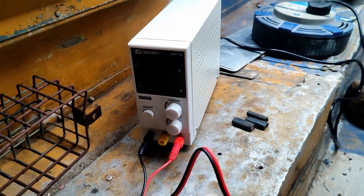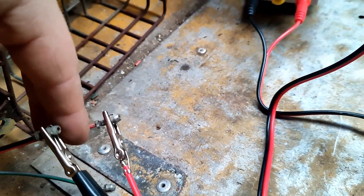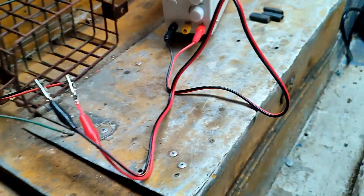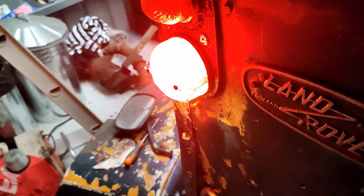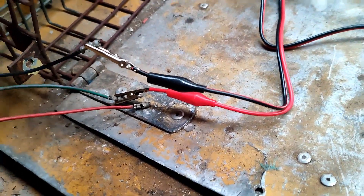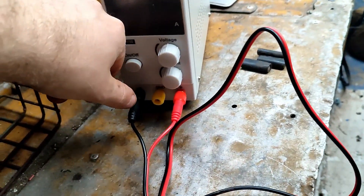Here I've got the power supply; our 230 mains has been fed in and I can control the voltage. I've had it set up already to 12 volts and you can see I've got it on the taillight — that red one is our taillight feed. So I'll turn this on; there you can see 12.3 volts. That's our taillight. And then if I swap this over — brake light — that's a lot brighter. You can do that to check all your bulbs, your horn, your fan for your blower motor, all things like that. Test it with the live voltage, make sure it's working, and then turn that off — that's safe.